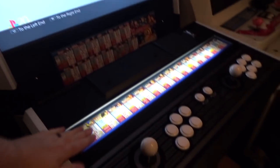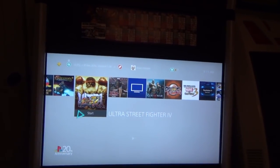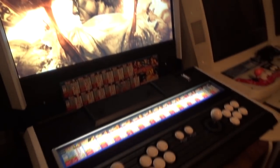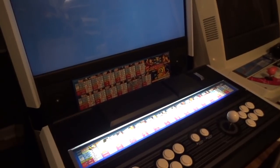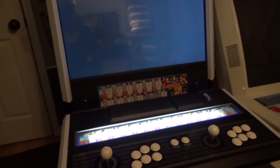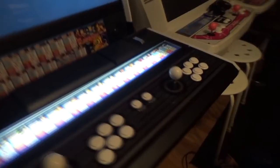They did include LED lighting under the glass on the control panel which is nice. One thing that kind of sucks is when you play a game and the audio hits - because the audio is pulling 12 volts off the power supply, it does this weird thing where it pulses. I'm assuming it's because it's pulling 5V and 12V from that power supply, and even though it's a beefier supply, when it pulls that current you can actually see it drop. What I did on the JAMA power supply was put a little voltmeter on it so when running JAMA games we can monitor what power it's pulling.